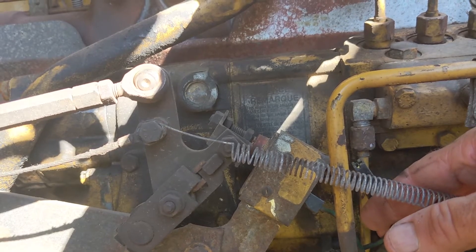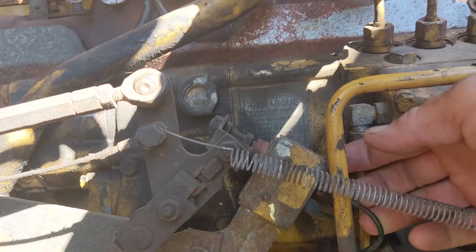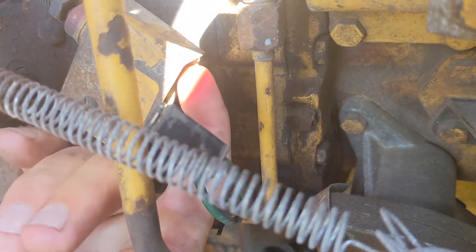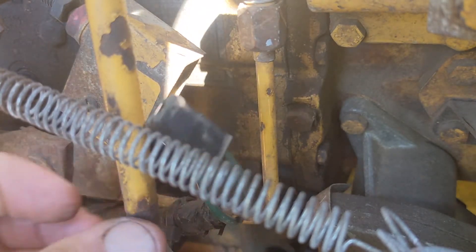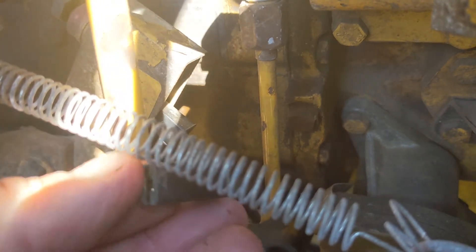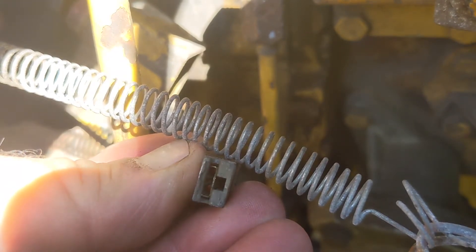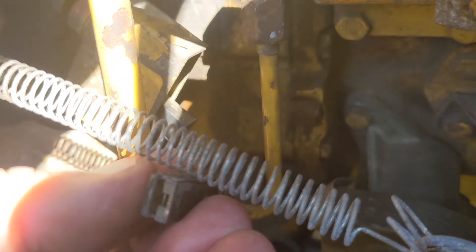Pretty cool to find this first off, because that's a very easy fix. If the blade is still on there, I can plug it back in and see if it works. There is still a blade on the switch — the male portion is there, which is a good sign. I pulled this out and it was in position over the blade, but it's really loose. If it's just touching intermittently, that would certainly cause the issue I saw, which is good to know.